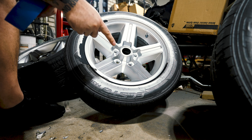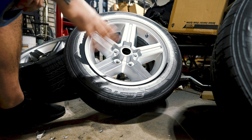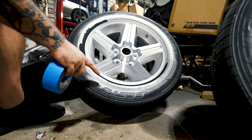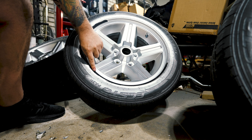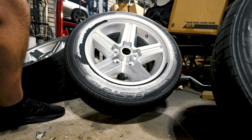So if you're going to do it, what I recommend is getting the six pack of the cans. I even had a can and a half or two cans left afterwards — these are only 16 inch wheels. Then masking off with some painter's tape, like go from here out. You don't want to try to mask off underneath here — it's going to be a pain, and it's also going to prevent the Plasti Dip from getting a lip around the wheel where it wants to grab.